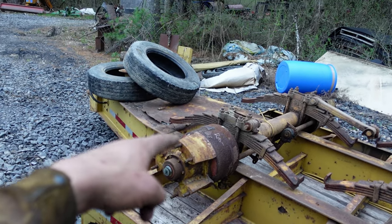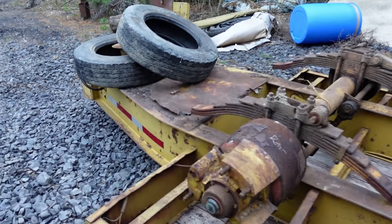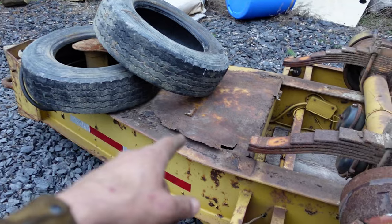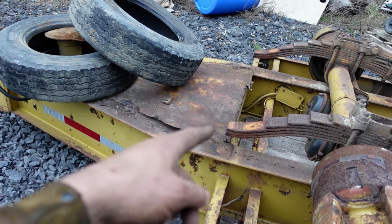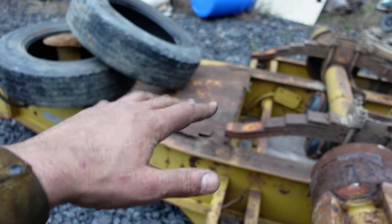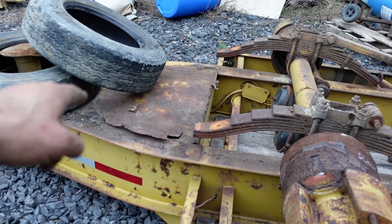Yeah, I got a front plate there. So I gotta snip that old floor pan off. They just put a pan in the underside of the frame here. So I got another piece that'll come a little wider, so I'll cut and grind that out of there and I'll stick a new plate on. And I'll do something they didn't do. I'm going to put drain holes in it.